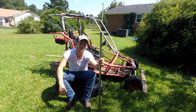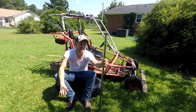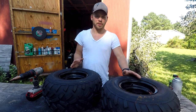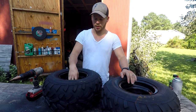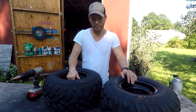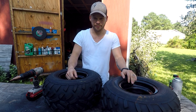What's going on everybody, we're back at it again on the dual 212 yard dog build. I finally got the axle in the mail - hopefully this one's long enough. I could not find the exact axle I need so we're gonna have to make some more modifications. I got my new axle in but unfortunately the only way I could buy it in the correct length doesn't have the step down. The hubs I originally had for this build are one inch to three-quarter inch step down, so the hole on the end of these hubs is not big enough. Luckily I've got step bits and a drill, so I'm gonna make it fit.